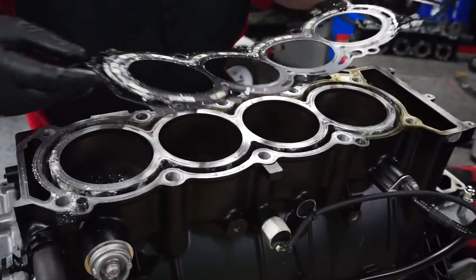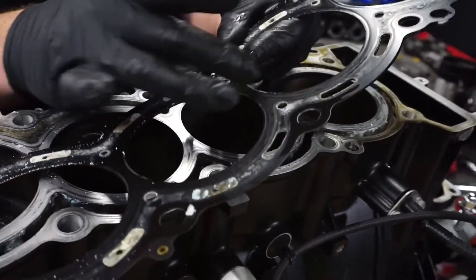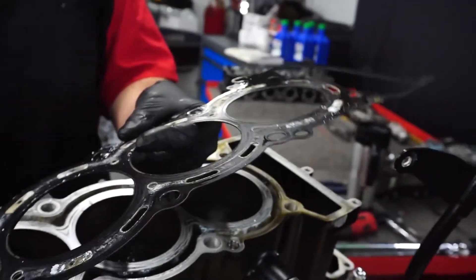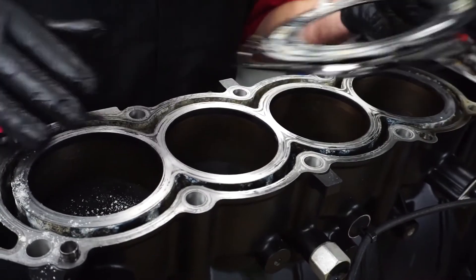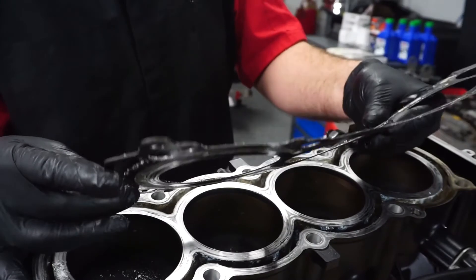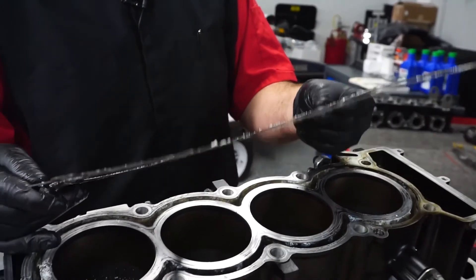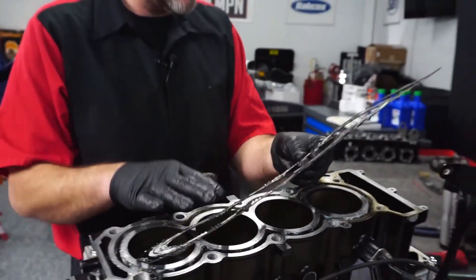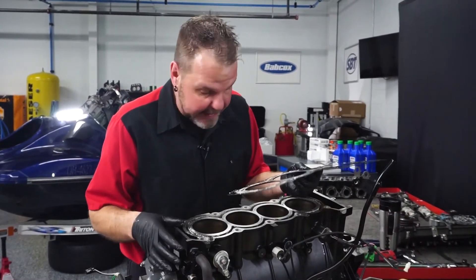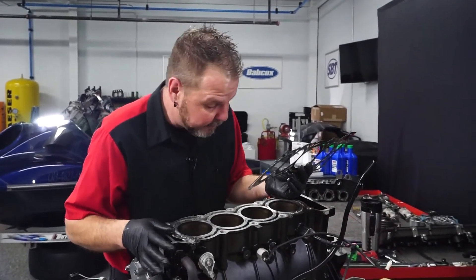And this is your head gasket. On a four-cylinder, your number one head gasket failure spot is right in this area here — so you're always looking for any damage to this when you take these apart. I'm not seeing any — there's no evidence of a head gasket failure here. We were burning oil, but this head gasket does look structurally and integrally good. We don't reuse head gaskets — you never reuse head gaskets. We will be replacing this with a new one from SBT when we reinstall everything.